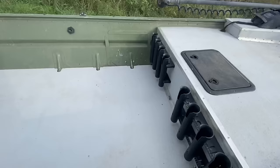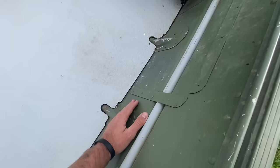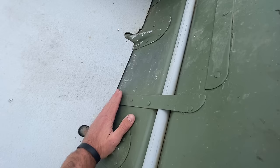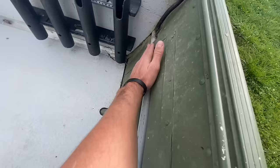A lot of people asked if it was hard to cut this bench out and how I did it. I could have taken each rivet out individually, but none of the rivets in here leaked and I didn't see a reason to mess with them. So what I did was come in with a 90-degree grinder with a cutoff wheel and just cut along the edge of the bench. After I cut it off, I took a flap disc on the grinder and took the sharp edge off.